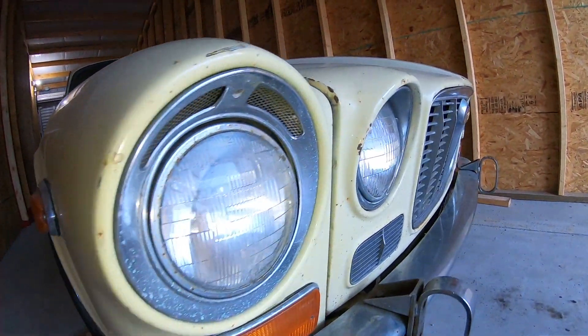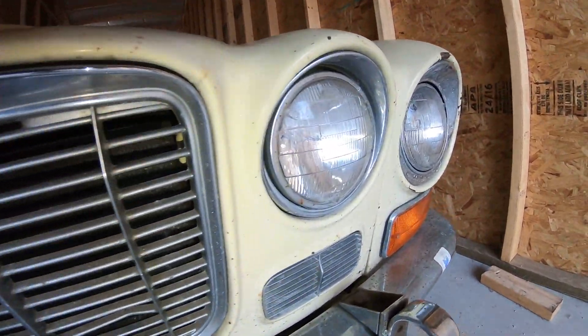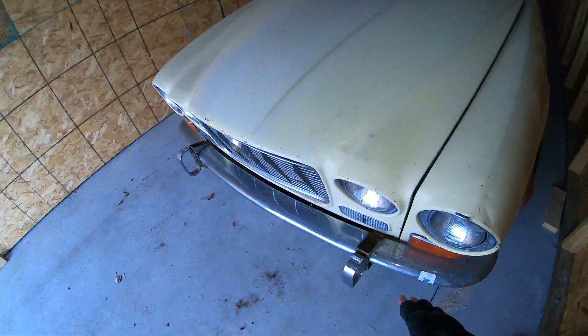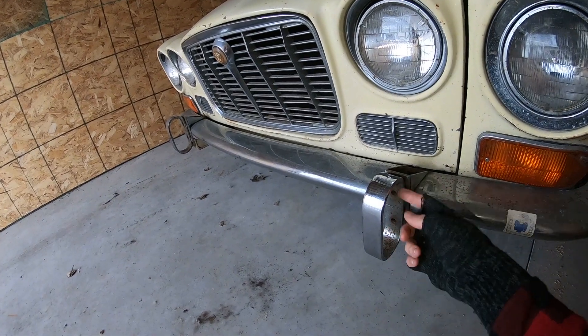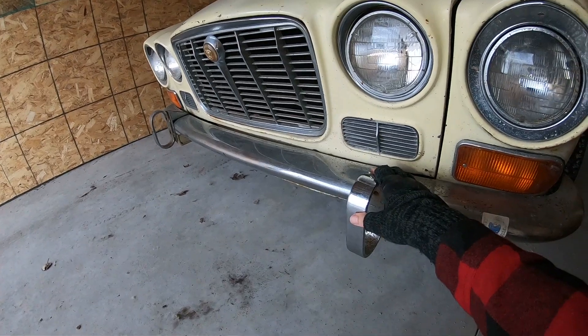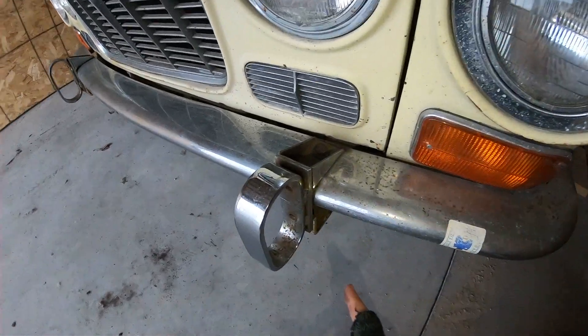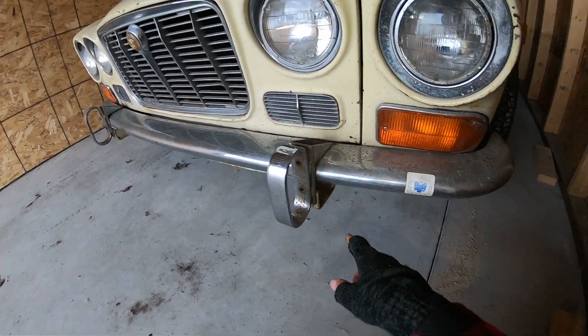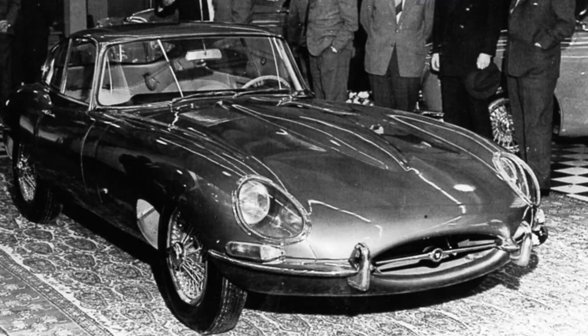Back in this episode I'm just going to go over the new investment opportunity I partook in here. So again this is a '73 Jag XJ6 — this is the last year of the Series 1 car. This has a one-year-only bumper treatment which is really ugly. There is supposed to be some sort of rubber trim that connects this hoop to the bumper. I'm going to be removing these overriders completely and trying to install the real Series 1 bumperettes, which actually go here.